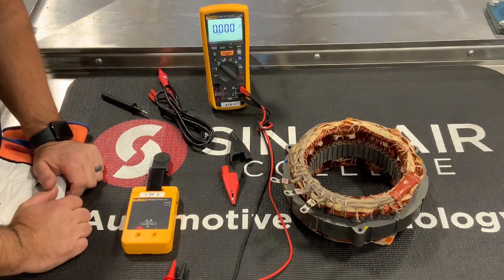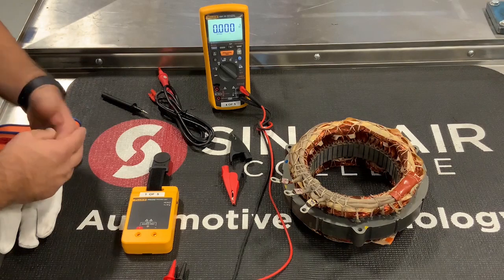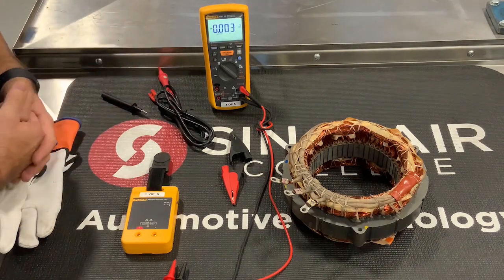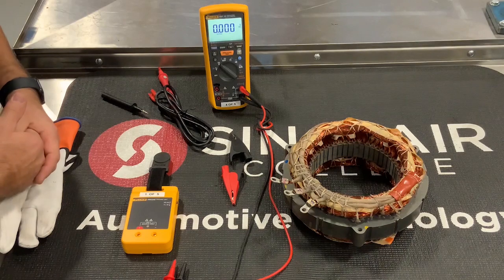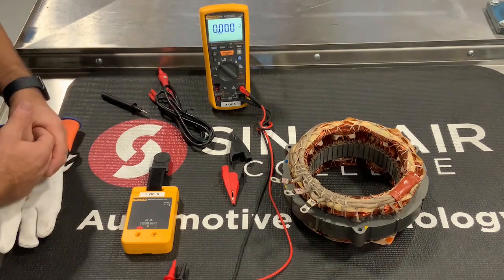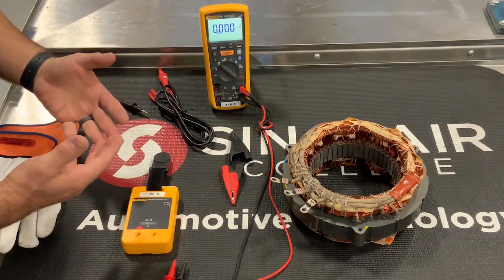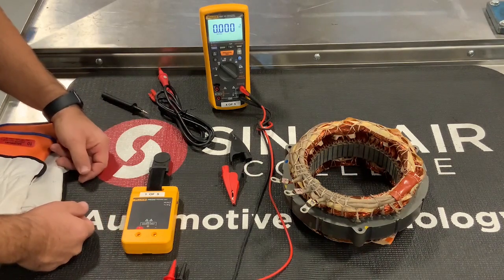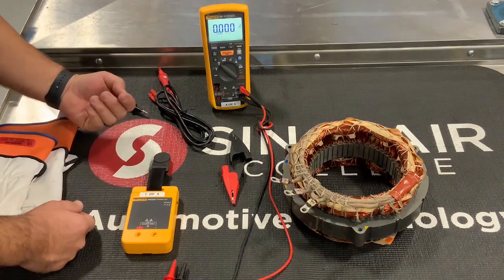Today we want to show you the mega ohm meter and how to use it, but also prove it out so that you know you can rely on it for testing high voltage. This type of meter is used for a couple of things — if you're using it as a voltmeter, perfectly fine. But you want to make sure the meter works and can tell you if high voltage is present. Most power-down procedures or high-voltage checkout involve going to a high voltage component and making sure it doesn't have any high voltage after you've disabled the car. That's all well and good as long as you know you can count on your meter — we're counting on it to tell us there's no voltage, but we're assuming we have a meter that actually works.